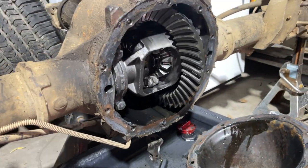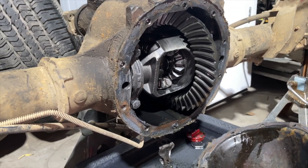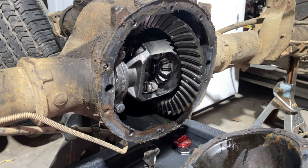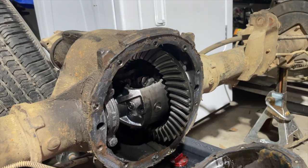It's been so long. There wasn't a whole lot of fluid in it — I know some leaked out. So I was putting some brake cleaner in it and I'm gonna let it sit for a while. I plan on trying to swap it soon, so I'm replacing the spider gears in this actually.